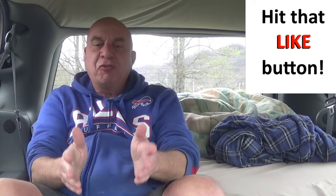So the swivel idea went out the window and I thought I'd just remove the seat completely. Now in a lot of vehicles - cars, trucks - you basically just have four bolts that hold the seat right inside the vehicle. You just take the nuts off, lift the seat off the studs, and you're done. But a lot of these minivans become more of an issue because you have some type of box that the seat is actually mounted to. And to remove the box, if you're not just taking the seat off and leaving the box sticking up from the floor, you have to go underneath the van.